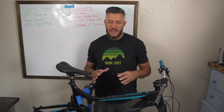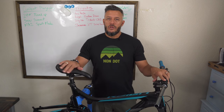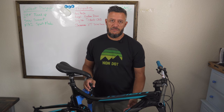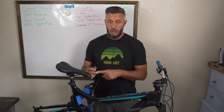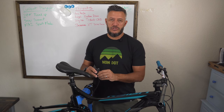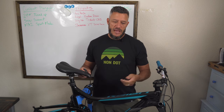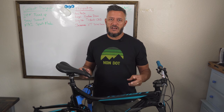You don't have to do that to replace one of these rear brakes. The cranks are also out — I just wanted to have as little on the bike as possible so that you can see in more detail what we're doing. So now that we have the rear brake completely taken off, what we're going to have to do is — this is a 2018 frame, so it doesn't have internal routing for all the cables, the cables are just loose inside the frame. We're going to tape the end of the old brake line to the new brake line and use that to pull it through the frame, so we don't have to spend countless hours trying to fish the new line through.